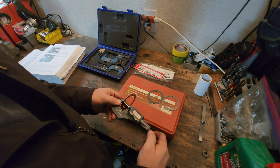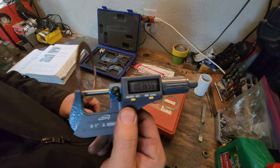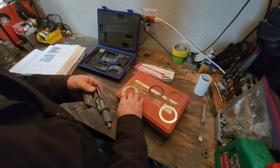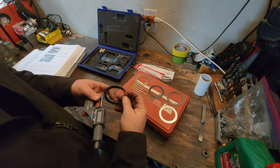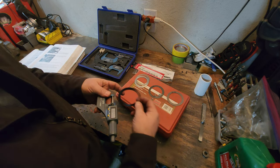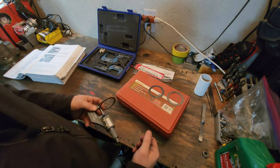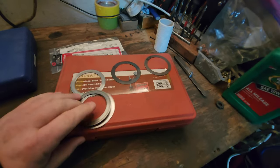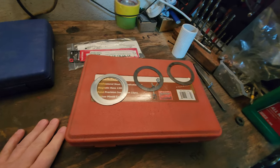This shim stack is kind of heavy — it's sitting at 36 thousandths, so that would be too much. Individual shims measure 14 thousandths, 11 thousandths, 11 thousandths, 12 thousandths. We're going to have to buy some shims. The shims I have here are not going to cut the mustard — there's a little bit too much thickness. We need to be somewhere around 30 to 32 thousandths.